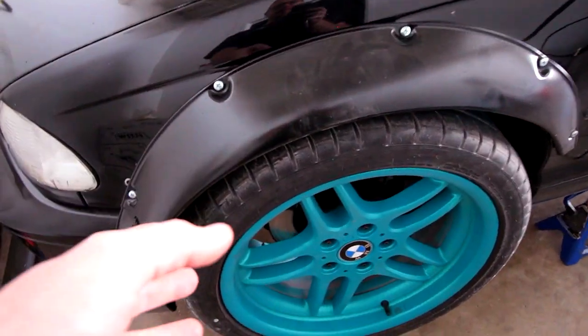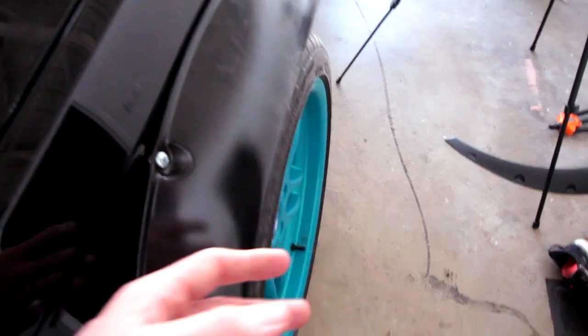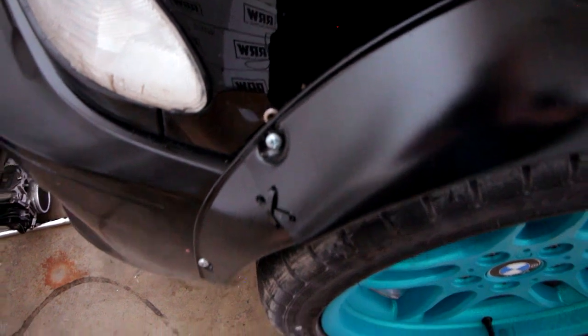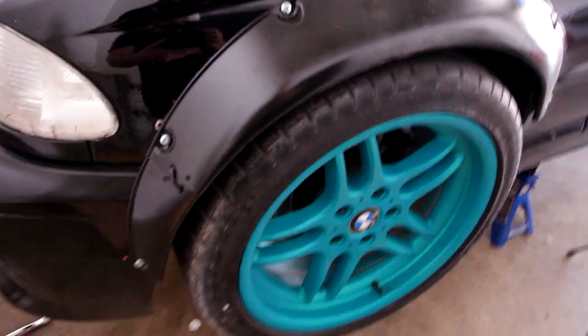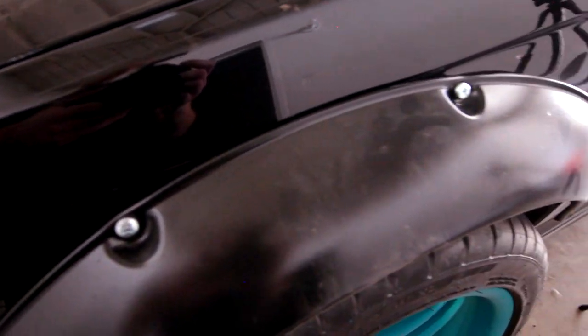For my needs I ended up buying a four-inch flare, which is pretty wide, but the factory E46 fender already has about a two-and-a-half to three-inch flare from the factory — so that's what I needed to clear the new wheel and tire setup. To make the generic flare fit better, I actually cut the flare and treated it like two pieces — one on the bumper and one on the fender — because on the E46 there's a notable gap between the fender and bumper and the shapes are so different. The fitment isn't perfect; you can see a slight gap in one area.